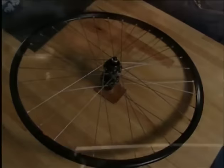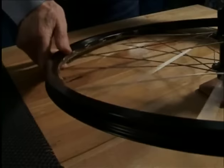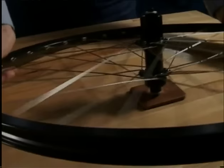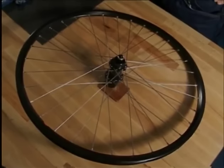If the spoke tension is already high, then the nipple tends to turn with the spoke as you tighten it. The spoke twists and only returns to the starting position when the tension is momentarily relieved. We relieve the tension by pressing the wheel down on the workbench. We repeat this process on the wheel 3 to 5 times, taking the time after each cracking to retrue until it no longer needs retruing and will stand up.